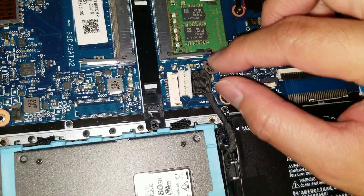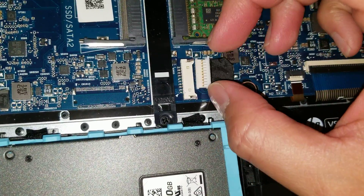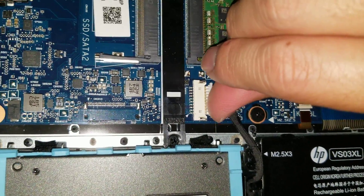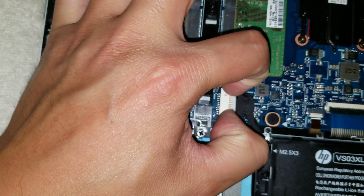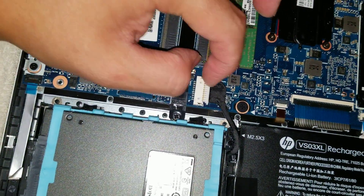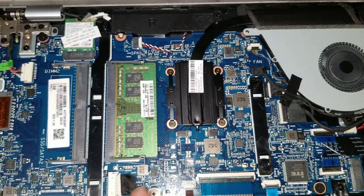Don't forget to put the battery connector back. Usually when I disconnect the battery, I also hold the power button for 30 seconds or so after disconnecting it, just to make sure there's no power — especially if I'm doing a screen replacement or anything like that, because the voltages can cause some damage. The RAM and the hard drive don't have a problem if you don't remove anything, as long as you don't drop some metal pieces on the board.